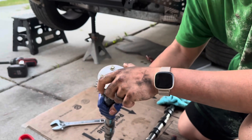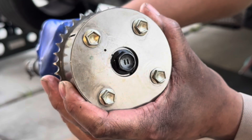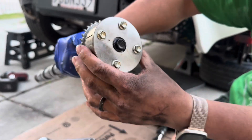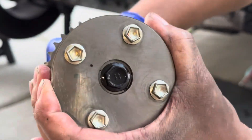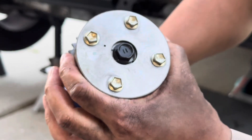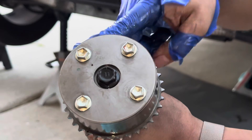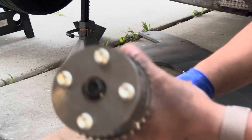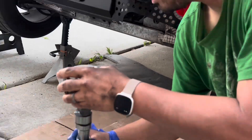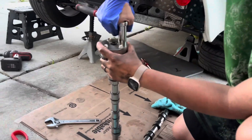Now that it's torqued down, go ahead and lock the gear — to lock it you just turn the gear. Now it's locked. As soon as you've got these two lined up — the inner dot and the outer dot — your gear is locked. If you skip this step you're going to run into issues with limp mode and you'll never really be able to hit second cam. Very important: unlock this gear before you put it on, torque it down, and then go ahead and re-lock this sprocket gear. Now torque down those five-sided bolts.